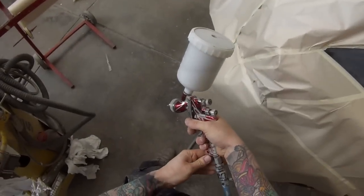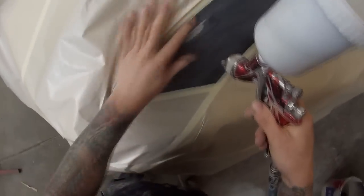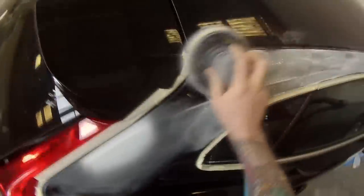Just doubling that paper up in a couple of spots. I didn't end up covering the entire car — it wasn't necessary for the pressure I was going to be using. Just got the pressure right down, gave the gun a quick test spray to make sure it's spraying correctly before you go and spray it on the panel. Just one coat, blow it down with the air, flush it off quickly, then my second coat, and then unmasking. For memory I actually gave that two or three minutes with the heat gun just to help it dry — just be extremely careful when you're using a heat gun.